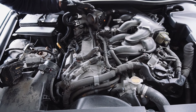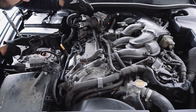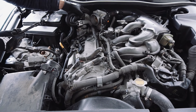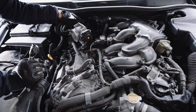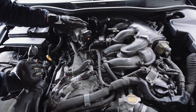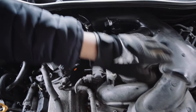The first thing in this process is to remove the throttle body. We're going to go ahead and take my 10 millimeter — there are four bolts here plus a fifth bolt on the side right inside. We just took off the bolts out of the throttle body. We're just going to put the throttle body right here and not touch it. Then we're going to start removing the lines to make sure we can remove this properly.